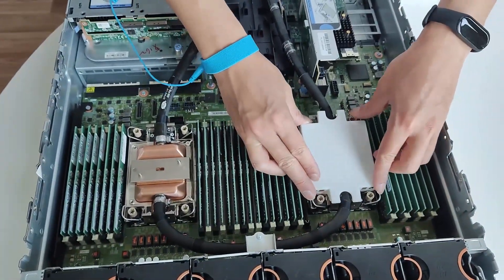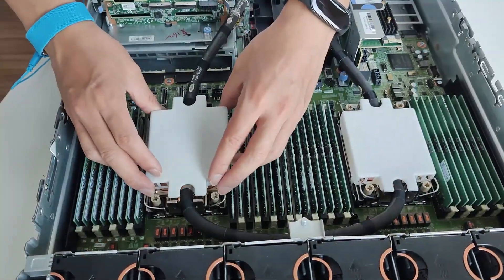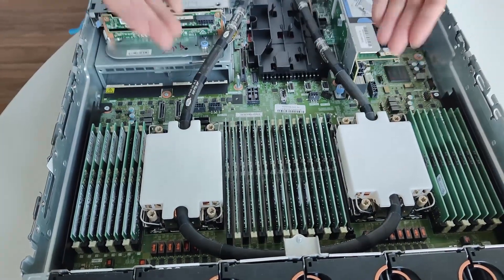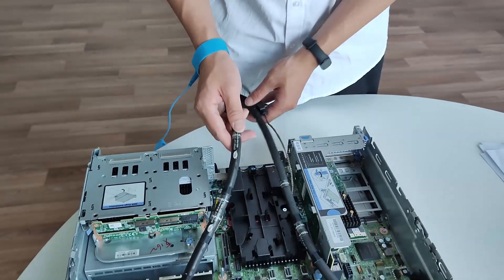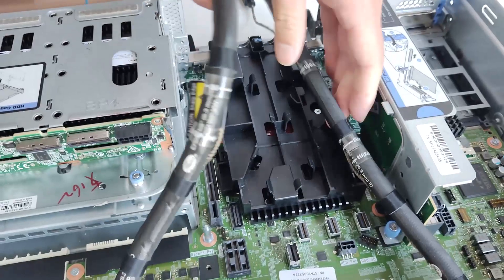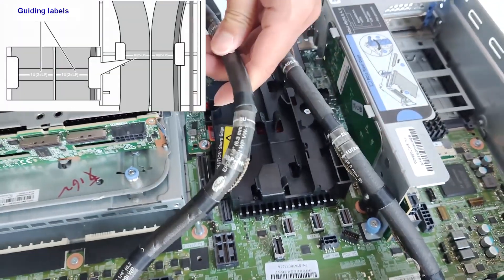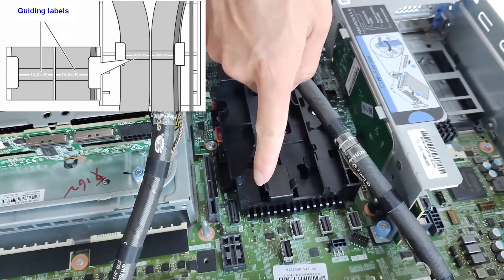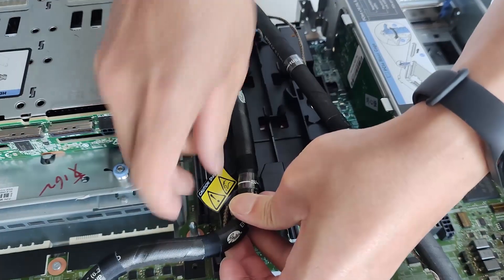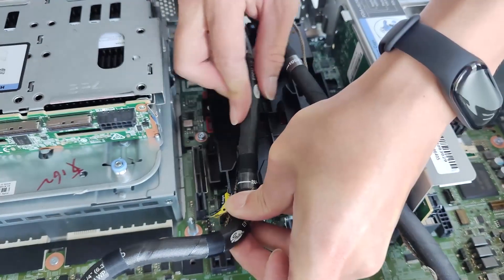Install the cold plate covers and press the cover down as shown. Place the middle part of the hose against the blue latch, then insert the outlet and inlet hoses into the holder. The hoses have guiding labels attached, so check for the labels before installation. Align the labels with the holder latches; otherwise, the hoses might obstruct open connectors on the system board assembly.